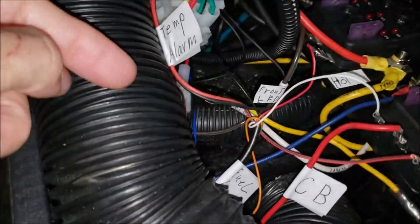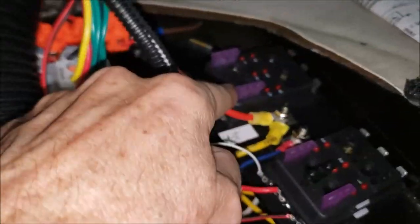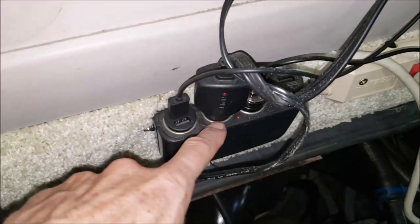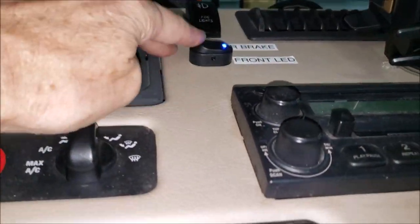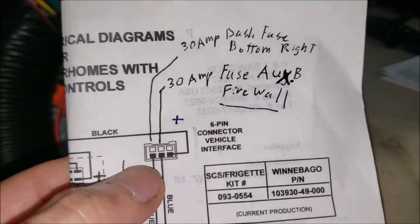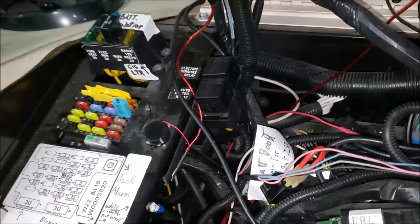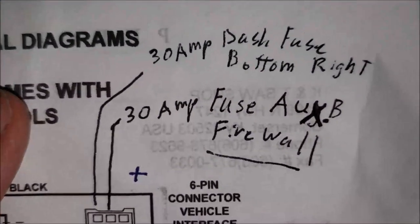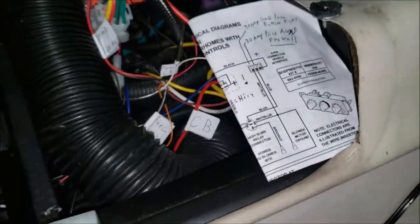I put my little notes back under there so I can keep up with everything — remember how strange the fusing is. You've got one fuse out on the firewall and one fuse inside on the dash, that silver 30-amp at the bottom. Something to keep in mind if you ever have issues with your blower motor and it's not working right — we've got two fuses to deal with. I'll keep that tucked under there, close it all up.